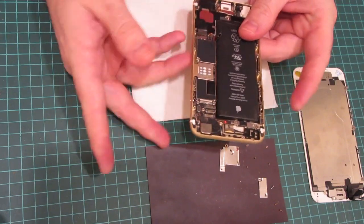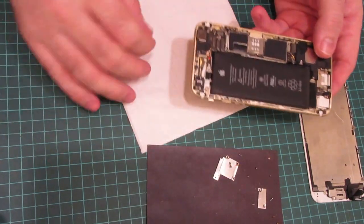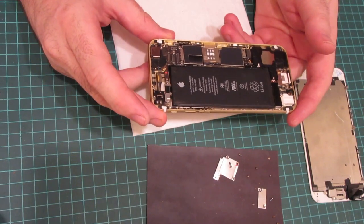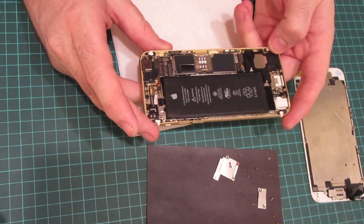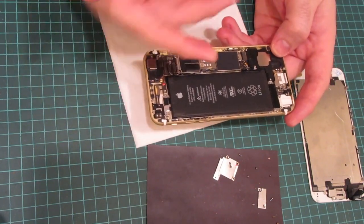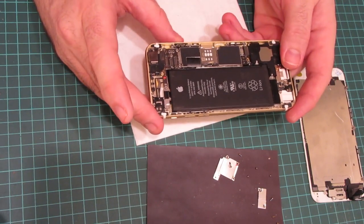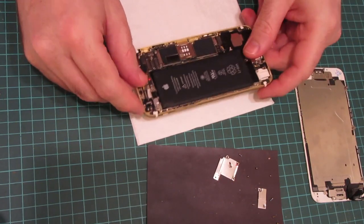There are enough anecdotal stories about people who managed to save their phones by just leaving it in rice for a week — which, of course, the rice does nothing really — and it works, yeah, that happens. But 99% of the time, people just lose their phones and their data, when they really probably didn't have to. If they'd just been told straight up, look, you've got water damage, you need to back up your data — the problem isn't going to magically go away, you just have to write it off. Sure, if it works for now, great, but you're really, for the most part, living on borrowed time. And from a service point of view, you're telling people that their phones are just fine after you've scrubbed them up from water damage — it's false hope. That's going to come back 75-80% of the time, and people are going to be pissed off with you, because you've charged them a bunch of money and the phone still didn't last that long.